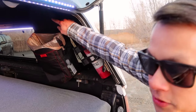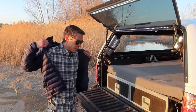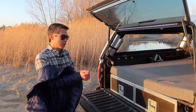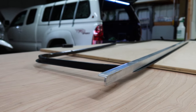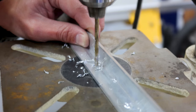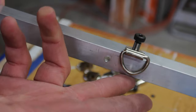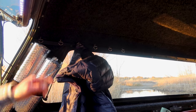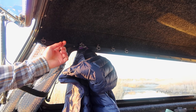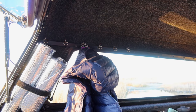You can't leave no trace without a garbage can. Another feature I wanted was a coat rack, and again I had to get creative without drilling into the fiberglass. I got a length of three-quarter inch aluminum angle and drilled and tapped it for little shoulder bolts to be used as hooks, and again used the window frame screws to attach it. I also put on some d-rings just in case I wanted to mount anything on a cargo net to the ceiling.